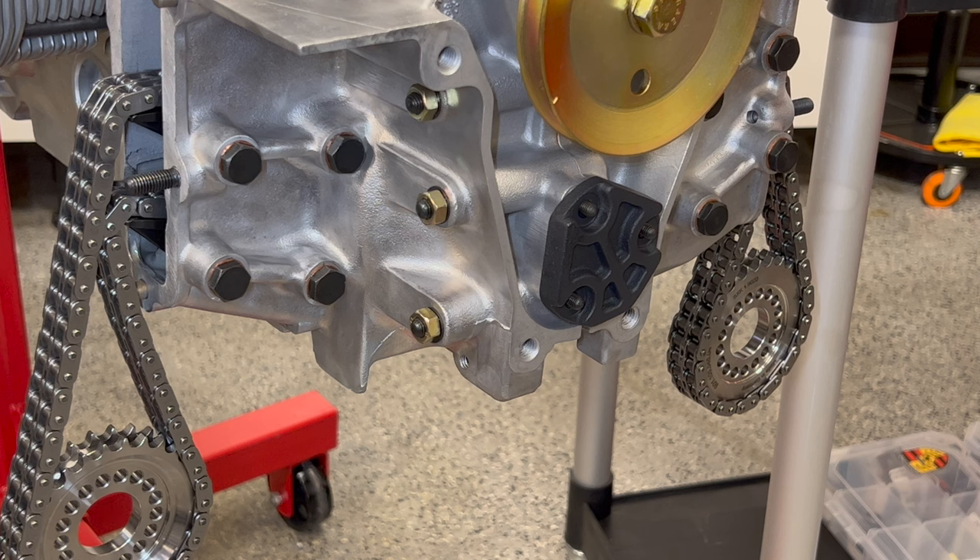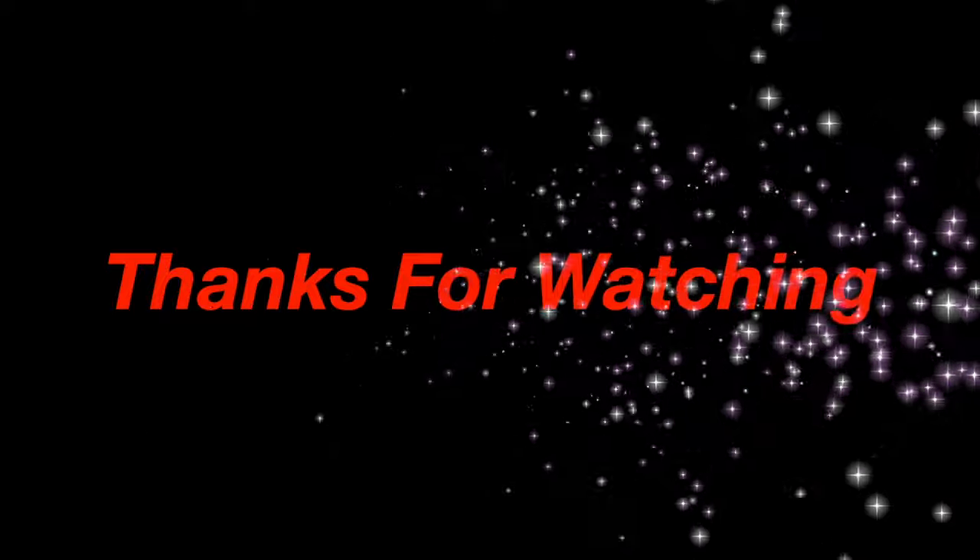Okay guys, so there is the intermediate shaft end play and how you get to that equation. The main thing is that you do have some end play in there and it's within that range. You can do it with feeler gauges or a dial gauge setup, but the main thing is that you do have some end play and it needs to be within range. You're going to be limited to whatever is available in the form of paper gaskets and metal shims to get you close to that. Every engine is going to be different depending on your case and your intermediate shaft - whatever you need to do to build up that thickness, that's how you're going to get there. Thank you.